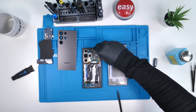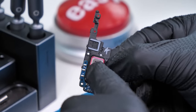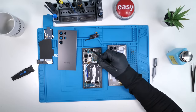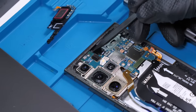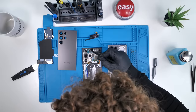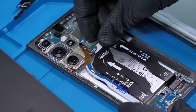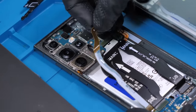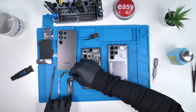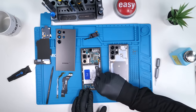We'll pop off the front earpiece speaker. And it seems like we have an antenna board over here. Then we have our front earpiece speaker with the rubber gasket for waterproofing. Our 12-megapixel front camera is right over here, and it's surrounded by black glue that makes your life incredibly hard if you're trying to remove it, so be careful. Now we can start disconnecting things — we'll start with these flex cables. There are three flex cables from the subboard to the main board. These cables do look different from last year's.